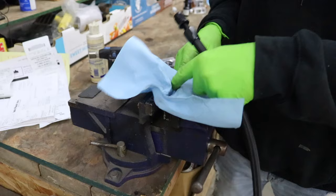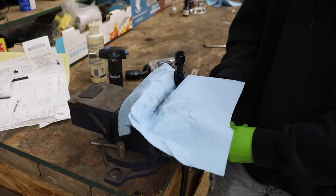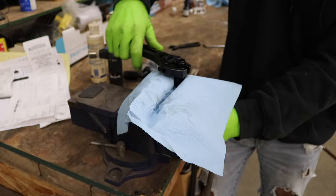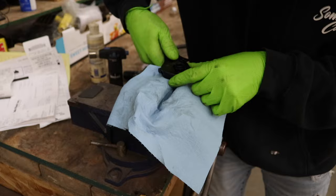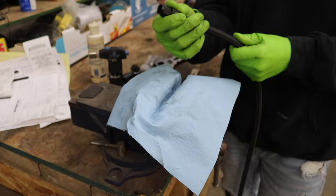Now that we've got that, we are going to take our other side of the end fitting and thread it in just by hand for now — as far as you can to make sure we're not cross threading anything. Then once it stops, if you have AN jaws you're rich. I don't have AN jaws so I just use some paper towel and tighten the vise onto my AN fitting very, very lightly because I do not want to squish it. Then grab your AN wrench and slowly twist this fitting together — it should go in nice and smooth. The nice thing about this adjustable wrench is it's a closed end so it really grabs the AN fitting. Once she bottoms, I like to tighten it until the hexes line up. Our first AN line is built — give her a tug, make sure it's nice and tight. That's one end done.